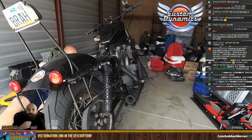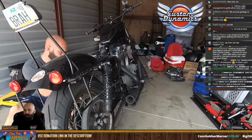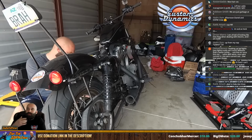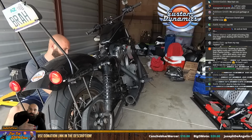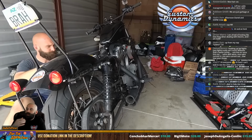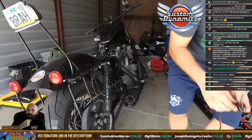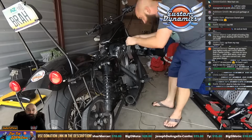I was like, okay. So I did that. He's like, did the LEDs come on? I was like, yeah, the LEDs came on. He's like, okay, so you got good battery, you got good voltage, this and this and this. And then we worked it. He's like, so where do you have it grounded? Well, I have it grounded on the frame, and I'll show you guys all in my review. He's like, okay, well, let's go ahead and take that off. Let's put it on the terminal. Let's try that out. I was like, okay. And so I did that, and it worked.